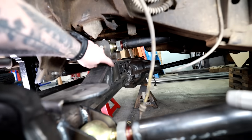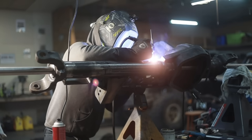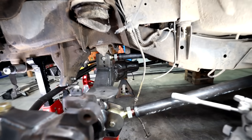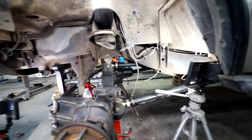I built this bracket into the front truss on the axle to make sure it's super strong, since I don't have a fourth link to give it extra strength. Something else worth mentioning: with a parallel three link or four link, you still need to run a panhard bar — and that brings me to my next suspension style.